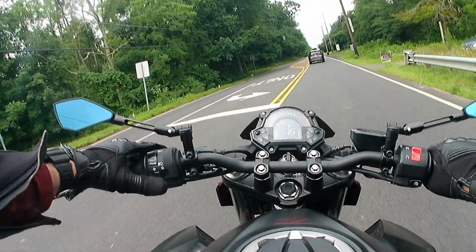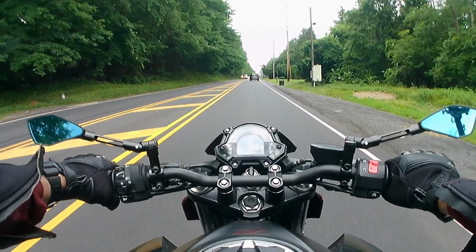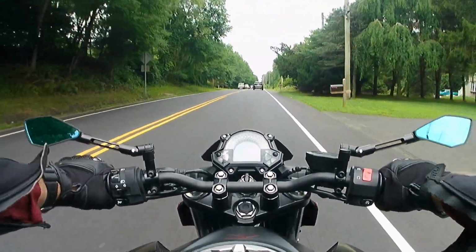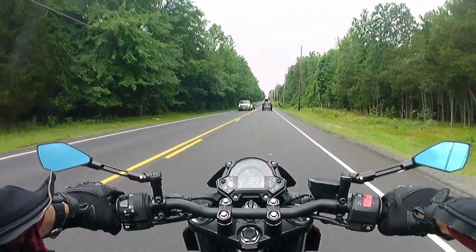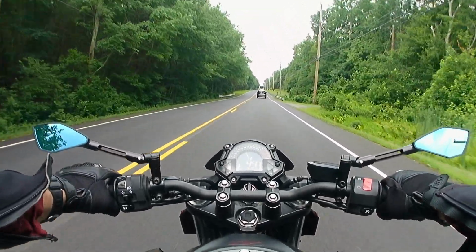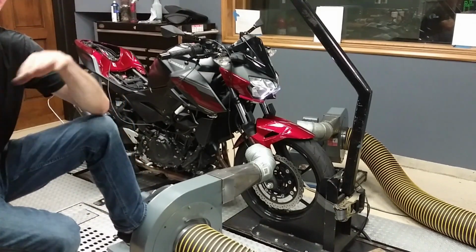The way it's going to work, I have a target. You see my target is 3,000. What that means is the dyno is going to go to 3,000 and stay there. It doesn't care if I'm at 10% or 100%, it only knows RPM. It holds the engine at 3,000, I'm controlling the throttle position, so we're going to sit right here on this box. At that time, we're going to be reading the exhaust the whole entire time.